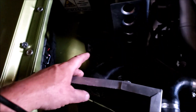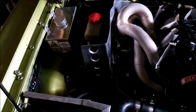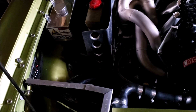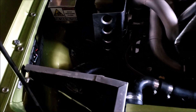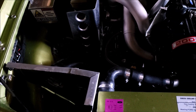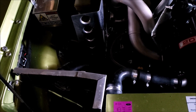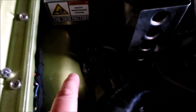The boost gauge down here has a three-port Mac valve. It's a bit hard to see. I had it plumbed up wrong — the same way as what I've seen on most YouTube videos — but it wasn't working for me. It was flowing as it should, but when it was energized by the ECU it was blocking it off completely. I think I have it around the right way now; it's in a diverted setting so it should do the job.